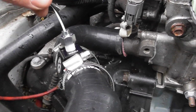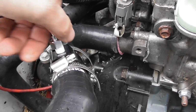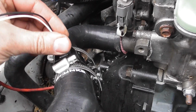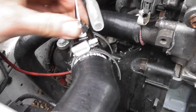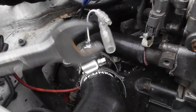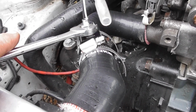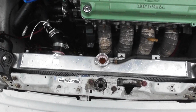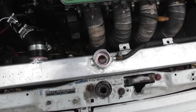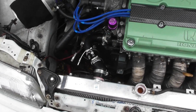I'm just doing that up. You can see if you've got the PTFE tape the right way around, it won't all be coming off. Went twice round with it. Okay, and then a 14mm spanner, and you can just kind of nip that up a little bit. So I've topped off the radiator coolant, and I obviously need to check if this whole thing's going to leak.